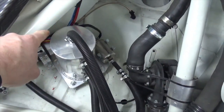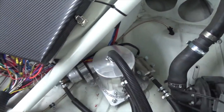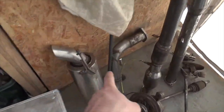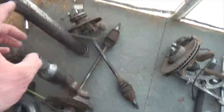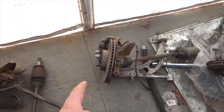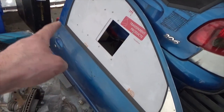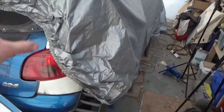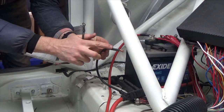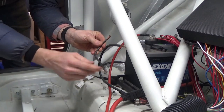I'm just changing the route of the power to the water pump to tuck it in a little neater with the wiring loom that goes to the boot. Whilst I had good daylight, I took the exhaust outside and gave it a good clean up. I also did the same with the rear drive shafts and hubs. I've cleaned up the fronts too but I still need to take the brakes apart, so there's more cleaning to do. I've also taken the doors outside to burn the dust off ready for those to get on the car. In order to save some weight, I'm going to reduce the length of the earth cable that goes onto the battery, and I can also remove the second earth which is no longer necessary.